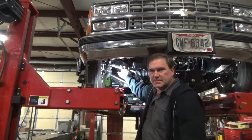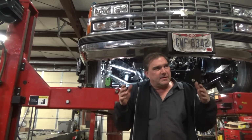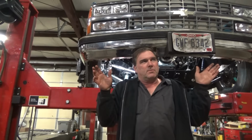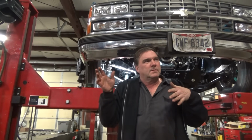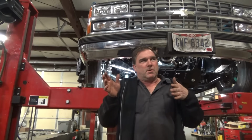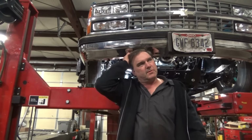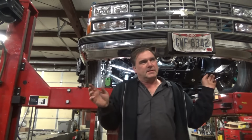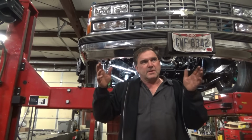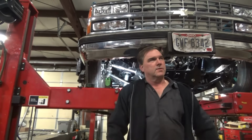Right now I have my tie rod ends within a 1/16 of an inch as far as length is concerned, but my driver's side on lift they both toe out, and they toe out a lot, but then the farther up you go, the driver's side ends up sweeping in and matching the other tire at almost 0 toe. So we're going -4 degrees, and then we're going back to 0 toe. So you would have to counteract that in the steering wheel, but the question is, why is that side toeing back in? And I think it's because of the rack with the tie rod ends the same length. I think the rack is offset in the car to the right, and the whole thing needs to go to the left.